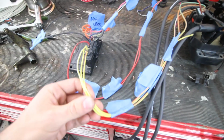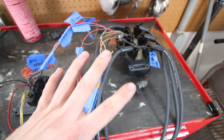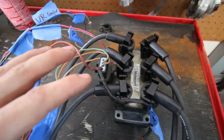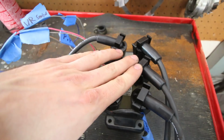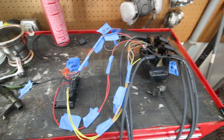There's a few forum threads online that explain a lot of this and how to get it to work best with EDIS-6. Specifically, there's one that's used in the Porsche 911, so I'm going to use that one. These should be all good. Those run over there. It sets the firing order for these. We hook these up to the appropriate spark plugs, and it should be good to go.